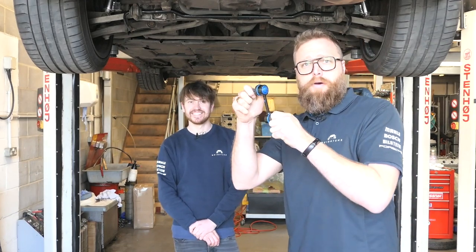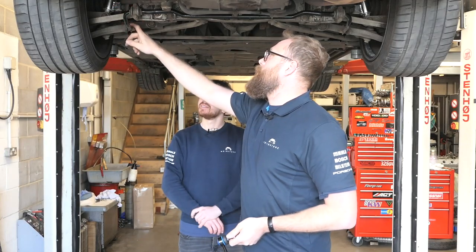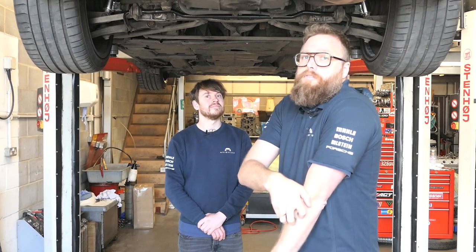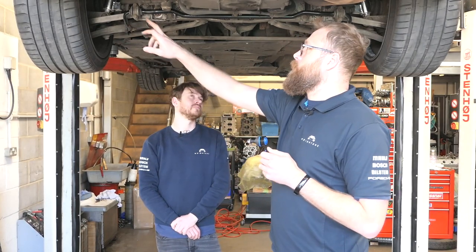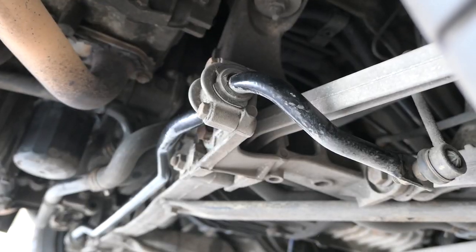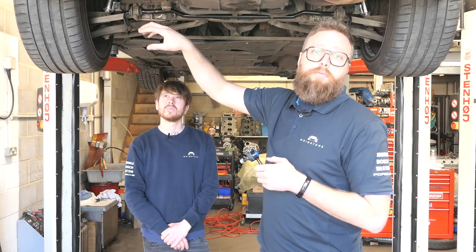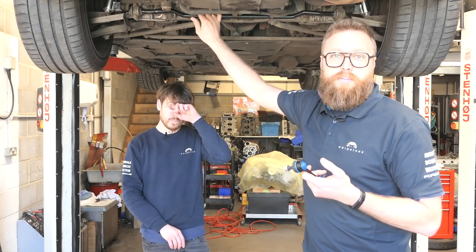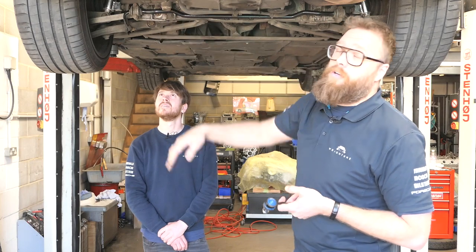And here we have my most favourite component — the rear anti-roll bar drop link, which connects to the rear shock absorber or strut and then to the rear anti-roll bar. Obviously that stops — or rather reduces — roll or sway. Americans call it a sway bar. On very early cars, they actually didn't have them on the rear. These commonly fail — the bushes here cause a knocking sound. Also the rubber bushes on the rear anti-roll bar itself can fail and cause a knock, and due to corrosion it can actually wear the bar away, so new bushes won't fit and you have to replace the bar. People fit bigger or stiffer bars to increase roll stiffness, or hollow bars to reduce weight — though a hollow tube also stiffens it up.